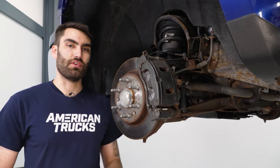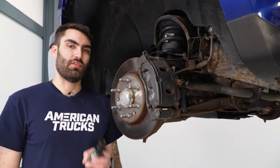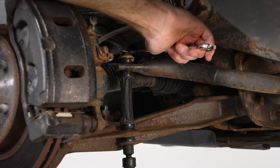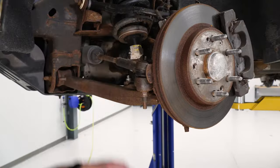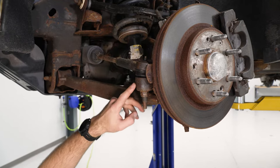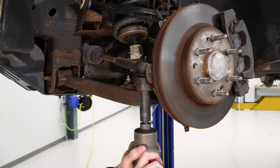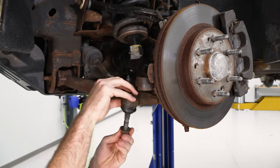You're going to want to do this one after another on each side so that we have it completely freed up. We can pull our sway bar up to get our end link out. I've got a 15-millimeter socket and wrench to take this off. Next, we can come to our tie rod end. We're going to take a 21-millimeter socket to remove this nut and pop our ball joint out of the knuckle. You can push up a little bit on your impact gun to pop it out, and then we'll push that off to the side.